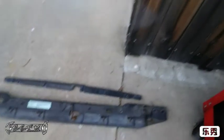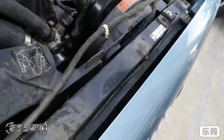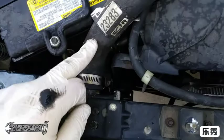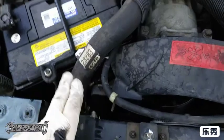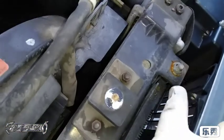All right, here's the radiator — it doesn't seem like there's too much holding it in. What we're going to do is disconnect this upper hose. This is a flathead clamp so I just unscrew it; if you have the squeeze type just squeeze and push them back. This 10mm has to come off because this is where it's attached to the condenser right here. Then also the lower radiator hose down there needs to come off.